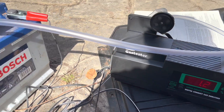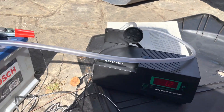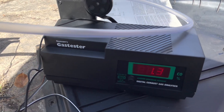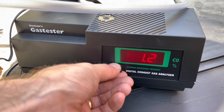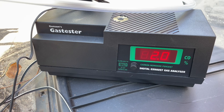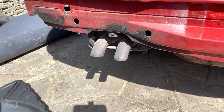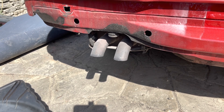Eight minutes is up. I'm not sure whether being a little close to the exhaust might affect the fresh air reading, but I didn't want the battery and tester assembly a long way from the car in case moving it disturbed things. There's a lot of wind today so I don't think it should have too much of an effect. I'm going to twist this up to 2 — it's a very sensitive knob. That is 2. I'm now going to wait for another two minutes before putting it in the exhaust. Our two minutes is up; the gauge is reading 1.9, so I'll just twist it very gently back up to 2, and then we'll put it in the exhaust.